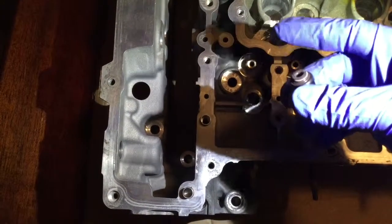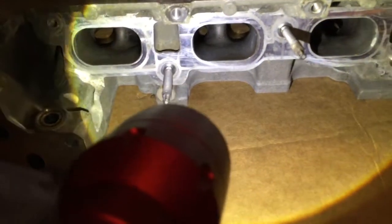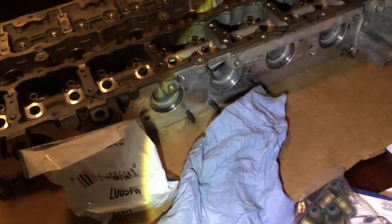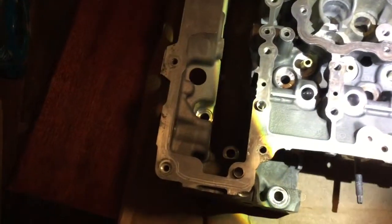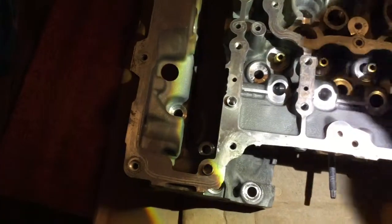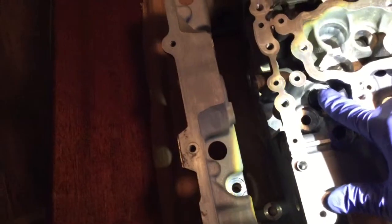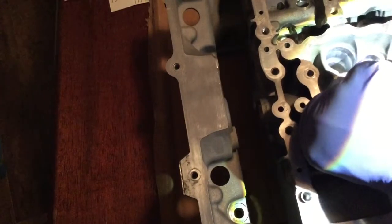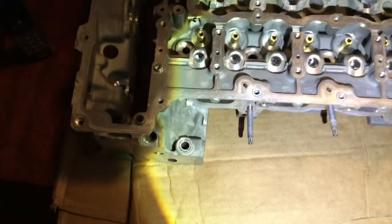The intake side - when you look at it, the parts are oval-shaped. The exhaust side connections to the manifold are round. The only thing you have to do is slide it on, but if it's a bit hard you need a tool to punch it in place. It is a bit hard, so I want to make sure I put it in straight - I'll use a tool.